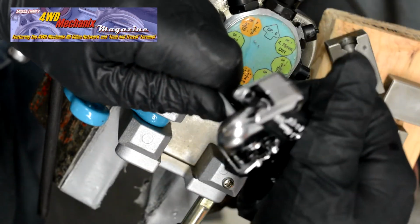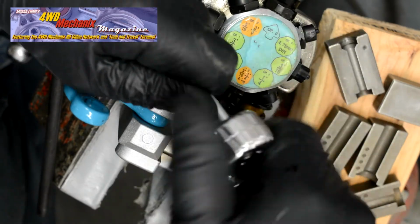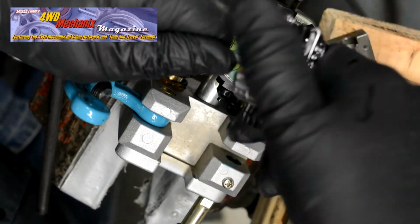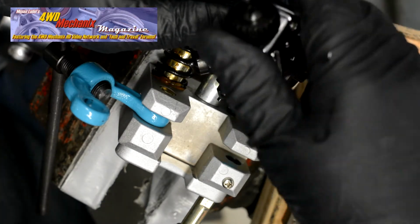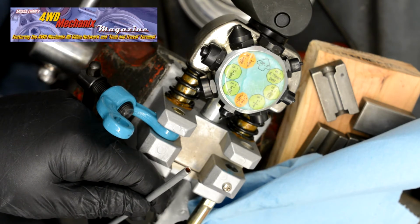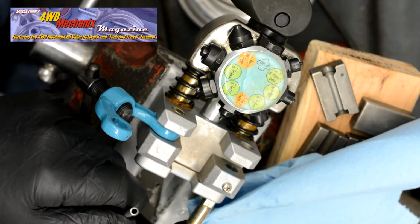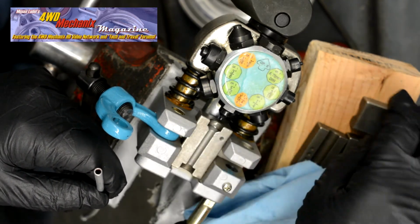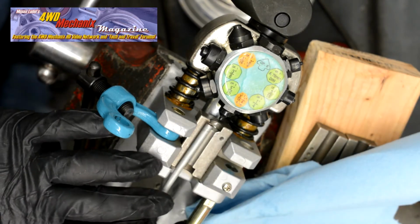The mushroom shoulder and the shallow second flare indicate that the tube was collapsing rather than folding where the lap needs to take place. Some causes for this kind of trouble include a tube end that isn't square, a tube end that has too much of a bevel, chamfers that are not sufficient, and lack of grease or some other cause that's preventing the tube end from readily collapsing into the adapter.